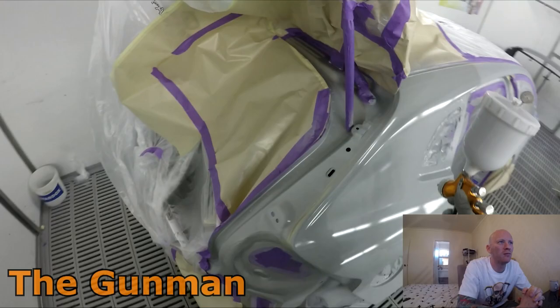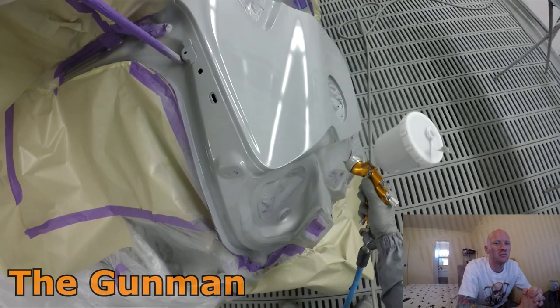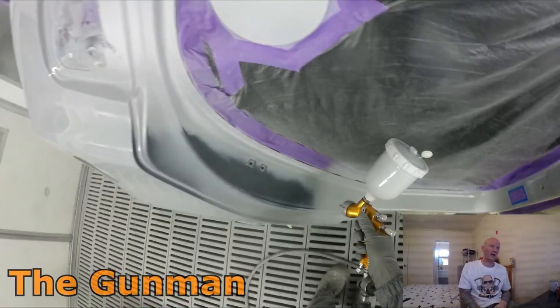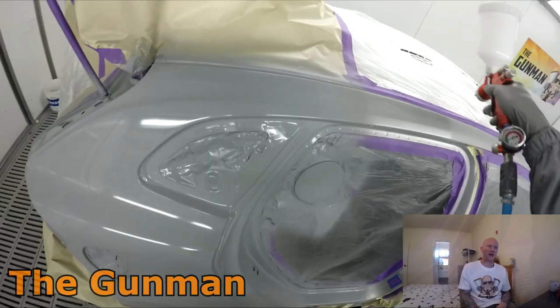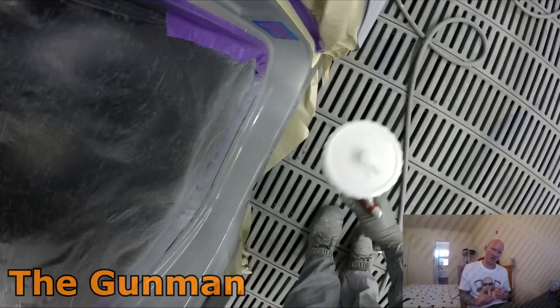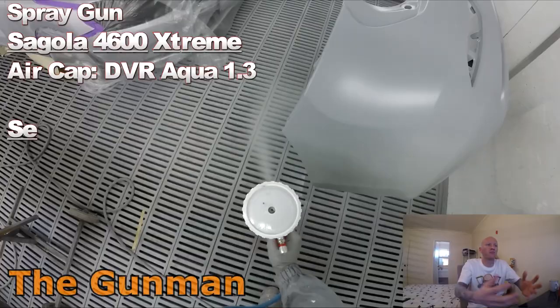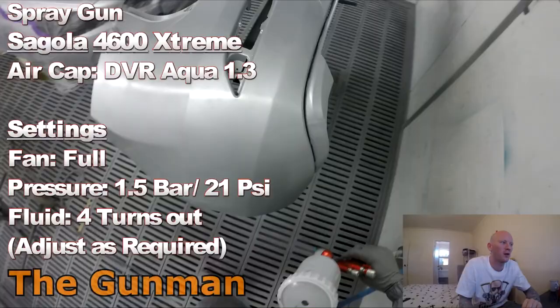to use fade out thinner, and I used it a few times in the waterborne, and it worked. But then there was one or two times I got really funny, weird reactions, and I think it was AK350 fade out thinner, and I think it was staying active under there. And then when I cleared it, it sort of woke it back up, I guess. And it started really weird reactions, sort of like a fry up, but not. So at the end of the day, you've got to try a few different ways, see what works, see what doesn't, and come up with the best methods, you know.